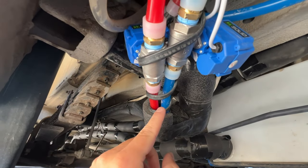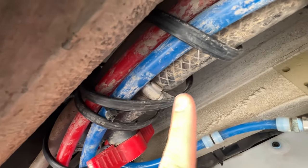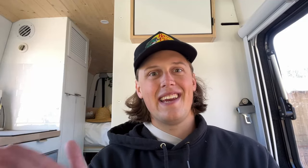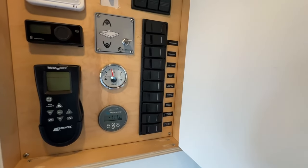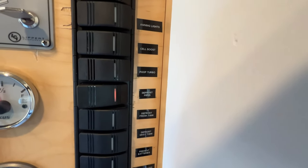Thing number two is heat tape on all of the piping that runs on the outside of the van. The idea here is that when it's Friday and I'm hopping in the van to go on a weekend camping trip, I can just come in here, flick on the heat tape switch, and all of the heat tape starts heating up, the pipes start to thaw, and by the time I'm camping — and for the duration of while I'm camping — the pipes stay thawed so I can just use the water system like I normally do.